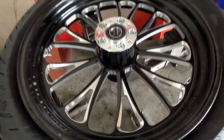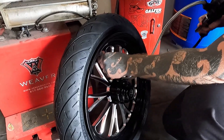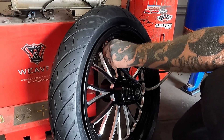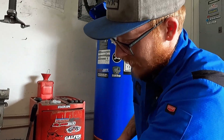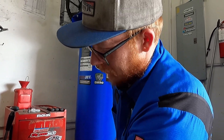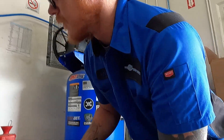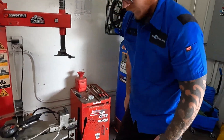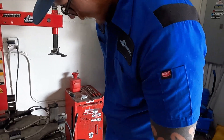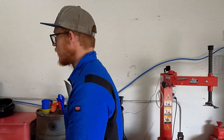I think I'm going to put a set of these on my Low Rider. In your opinion, what do you think is the best air pressure for a front tire? Well, it just depends on the tire and the bike. Bagger is different than Dyna — you got different variations. I'd say Dyna usually around 36. My bagger, I like to run at like 38. So it just depends on what you're doing. If you're trying to get that thing to pop up, you're going to want a little lower tire pressure.